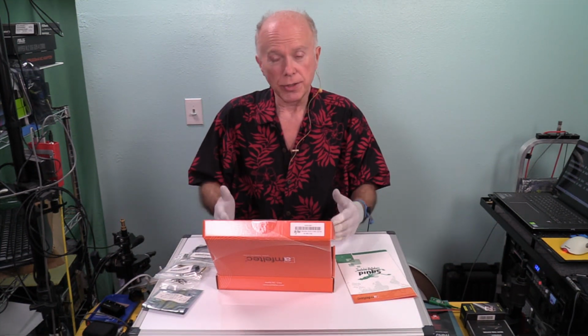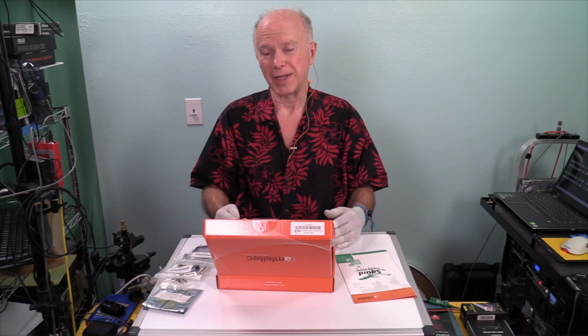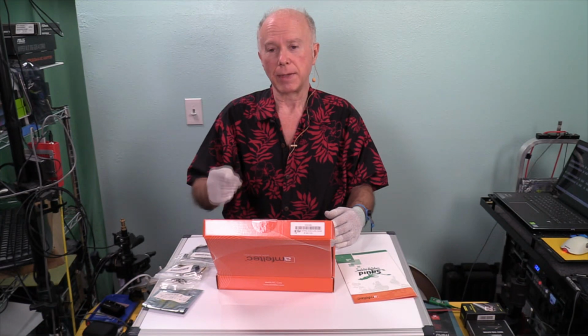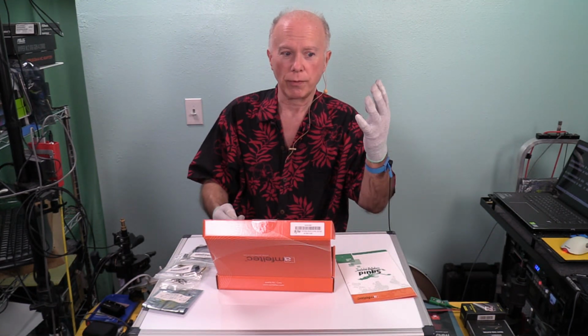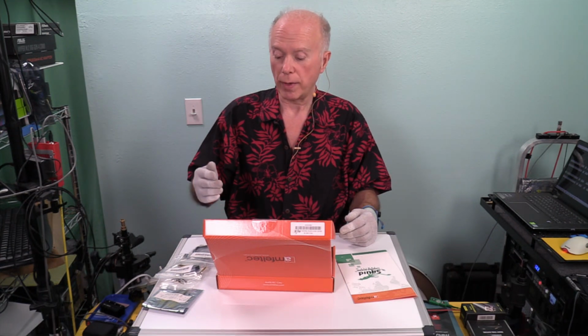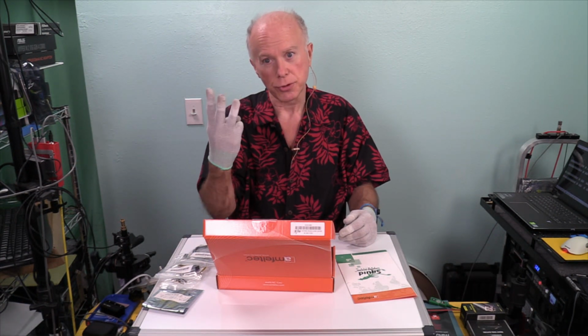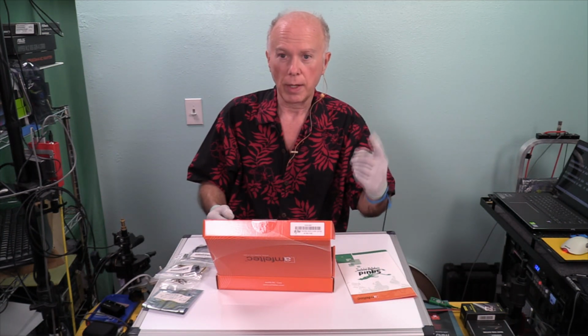Because for those of you that have motherboards that have shared resources, as we went through in the last chipset with a Z590, where you've got a 16-lane slot and you've got one 4-lane resource where you got 20 PCI Express lanes. However, when you bifurcate that primary slot, and you put a quad adapter in there, you only see 3 drives. So to see 4 drives, there's 3 on the quad card and 1 on the motherboard, instead of seeing 5 drives, which I think is nuts.